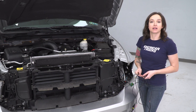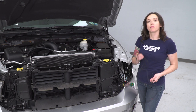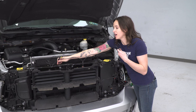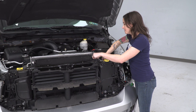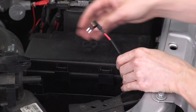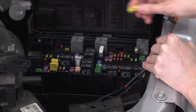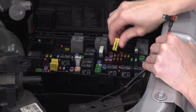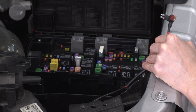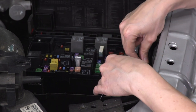At this point, we're going to install the optional wiring harness. This will allow you to have daytime running lights whenever your ignition is on, as opposed to the factory daytime running light option. We're going to route this wiring harness over to the other side where it plugs in, and then route this side back underneath so we can plug it into this headlight. Make sure it's away from anything that's hot, moving, or sharp. Now we're going to get this other end installed into our fuse and relay box. Locate F66, which is where Morimoto suggests to install it — there is a diagram on top to help you find it. Remove that fuse and install this one directly in its place, make sure it's fully connected, then route this wiring out the side and close the box.